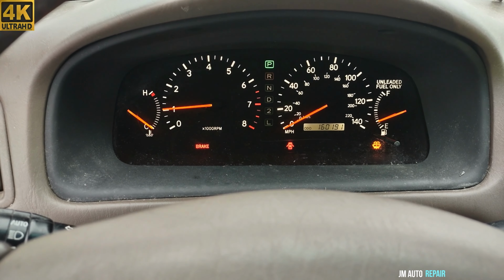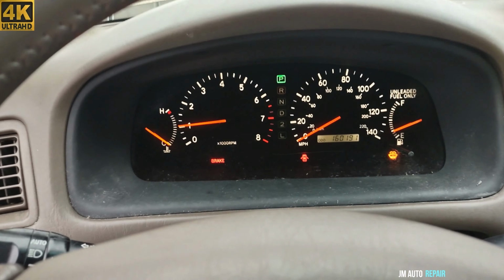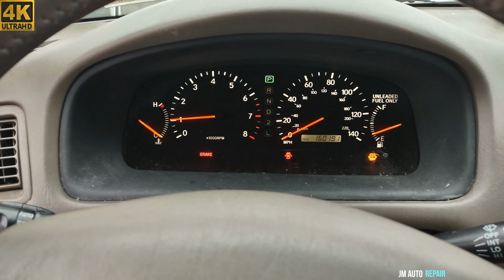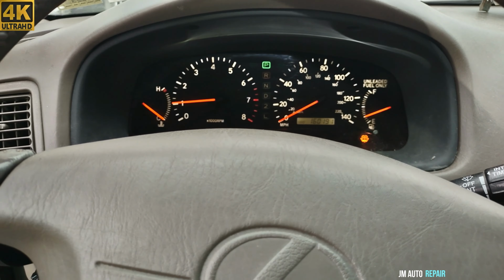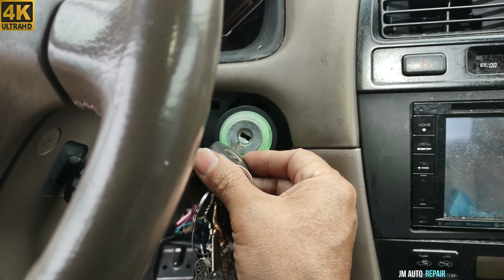I'm sure that is the problem with there, all those wires. So now I'm gonna fix them. I'm pretty sure that's the problem, but I'm gonna try to turn on the vehicle and turn it off a few times. But the fuse was blowing as soon as the engine would be cranked. So I'm pretty sure that is the problem right there. There it goes. Ahí está. It's not blowing anymore. All wires are separated there. So I'm only gonna fix those wires there and put everything back, and that should be it.